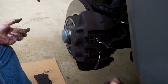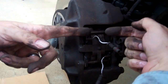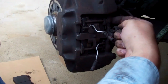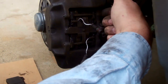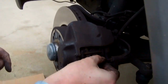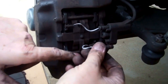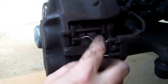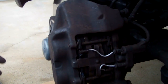Got that all set. The key point was to get everything straight — I had them a little misaligned, so I put the nail back in to check, and could see my pin was too low. I raised it up, used the screwdriver to move it around, did the same on the bottom, and hammered them flush — they stick up just about 1/16 inch. Then we plug in the sensor wire very carefully, making sure it's not caught on anything. Look around and make sure everything is nice and flat, not rubbing against anything. Looks good — I think we're all done.